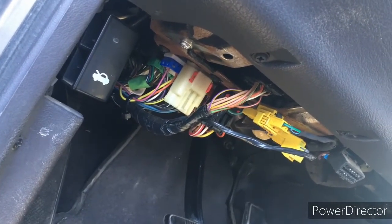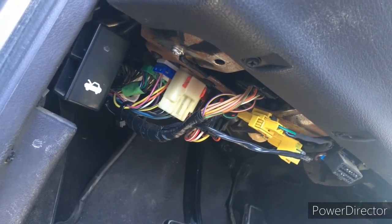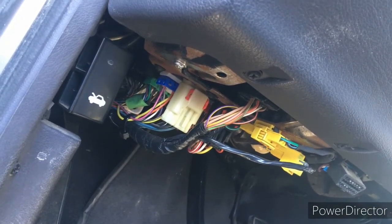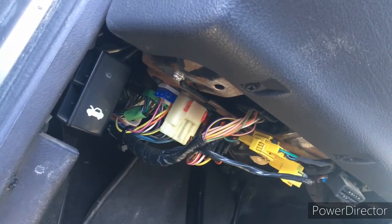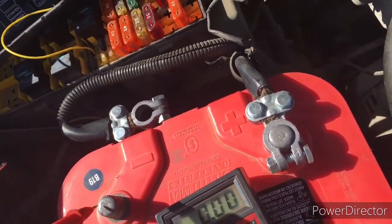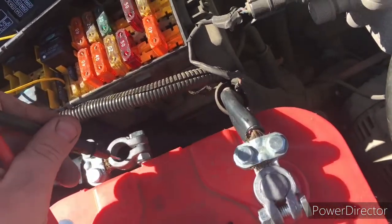And then my battery went dead. Well, it was wintertime, and it was minus 40. So, you know, batteries go dead in the cold weather, so I got another battery. This one was dead, beyond bringing back. I got another battery, put it in, and it died too. It shouldn't have in the amount of time it was in the vehicle, so I started looking at other issues. I'm trying to do this with one hand here, but I'm looking for an electrical draw that is killing my battery.